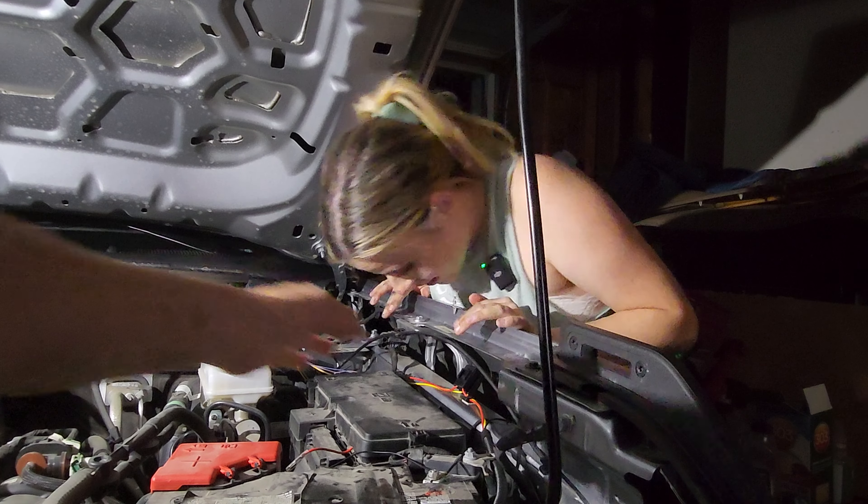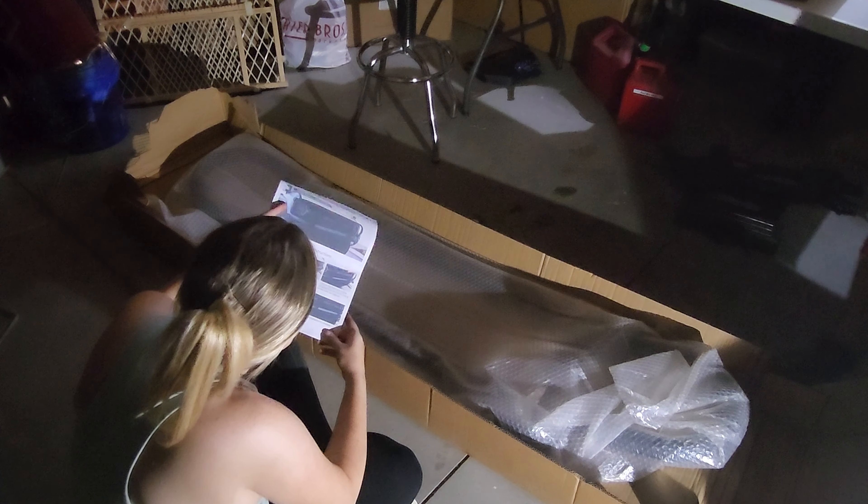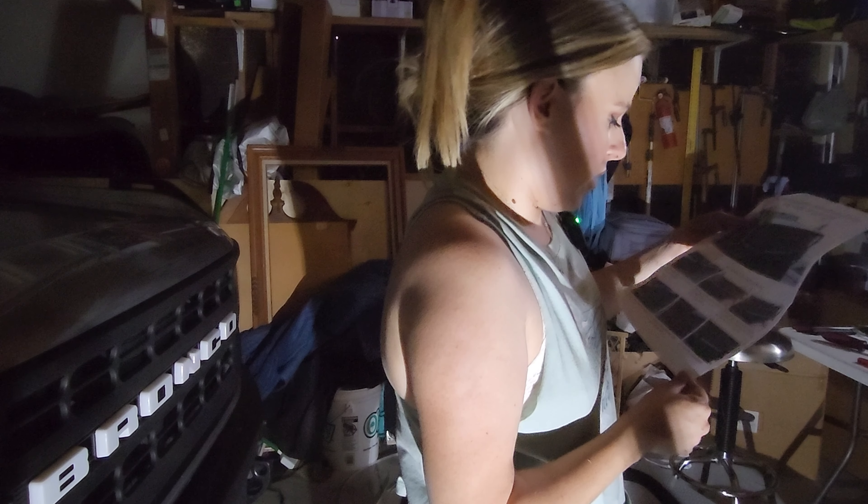Taking the red wire from the fog lights — which should be the white lights — and plugging it into the butt connector, pushing it all the way in. Then crimping and using heat to seal. Power on — aux four going on now. Aux five going on now. So they work. And for funsies, aux six — yep. Awesome. Everything is tucked, and the fuses are literally right next to the fuse box so you can still access the panel.